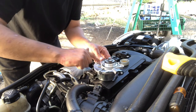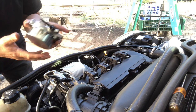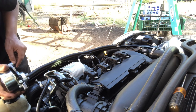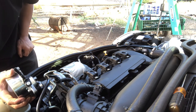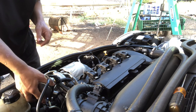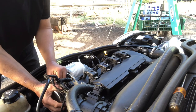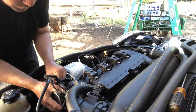You're gonna want to make sure these little grooves right here line up with the grooves on your cam. Hold it the way it came off, line up the holes visually, and see if they look about the same. Then you're just gonna fit it in there and slide it in until those grooves engage.